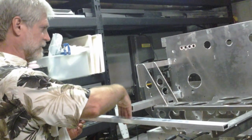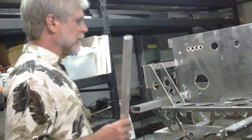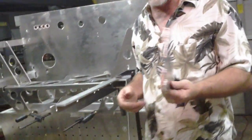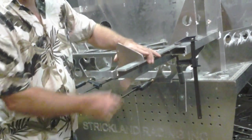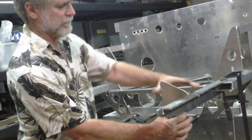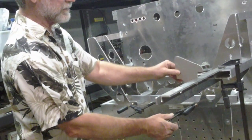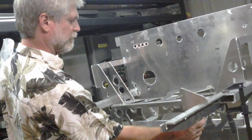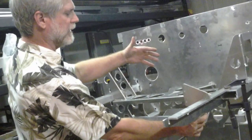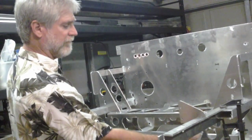The hatch release gives it a hard point to mount to. There's a bracket like this that goes in that notch right there. That's the air conditioner condenser. A similar bracket goes in this notch, which is the radiator bracket. This bracket is all one piece - it is actually the radiator bracket, it holds the fan in place, and it is the fan shroud as well for the radiator.